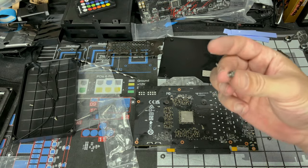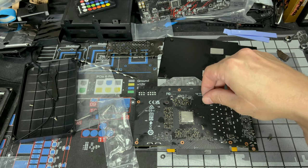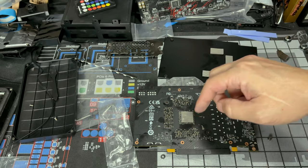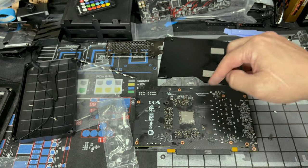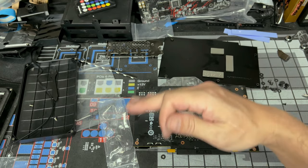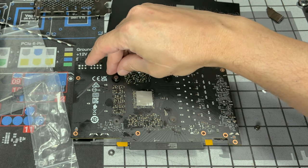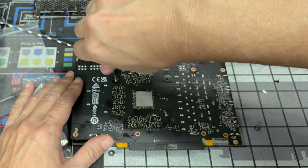Now we got those four, we're gonna have these. Now, remember how we removed them? Doing just a few turns and going opposing screws, not going clockwise. We're gonna do the same thing here, even when we tighten it. Only a few turns each going diagonally. We wanna apply even pressure across the entire die. So let's put our first screw here. We're gonna press down, because this is spring, and we're gonna go till it catches thread.